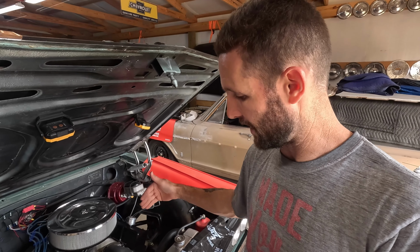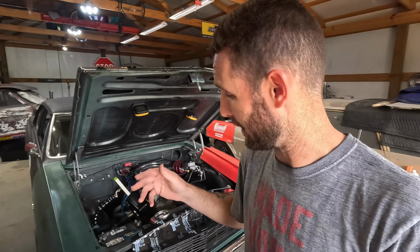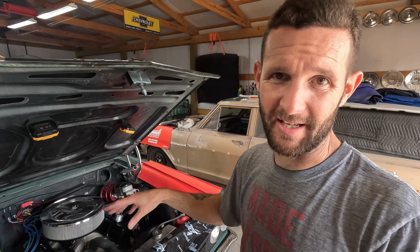Inside belts all line up, which means that the outside belt groove will also line up. As good as it can possibly be anyways. That's within tolerance of the fabrication of the pulleys. Nothing I can do about that. So we're all set there, but there's a catch to this.